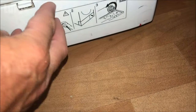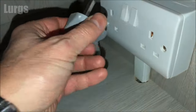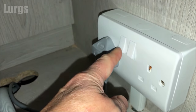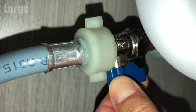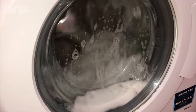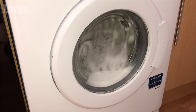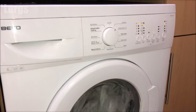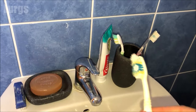It's a good idea to leave the panel open when you run a washing program, just to check that the filter's not leaking after you've put it back. Remember to plug the washing machine back in, switch it on, and turn the cold water feed back on. Then it's definitely worth running a 90-degree wash with Dr. Beckmann's washing machine cleaner, just to give it a good flush through and keep it hygienically fresh. Keep an eye on the filter to make sure it's not leaking. Hopefully that has fixed your washing machine.